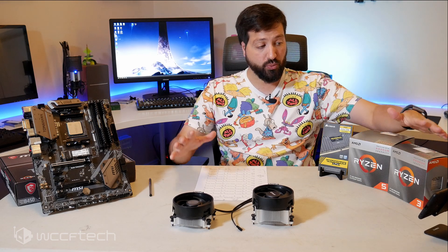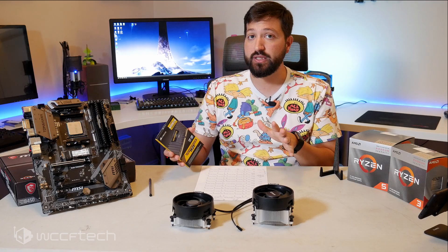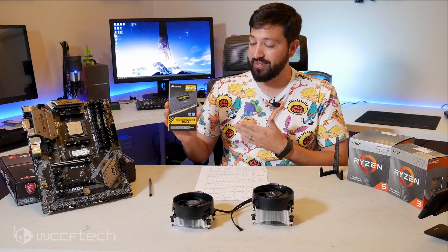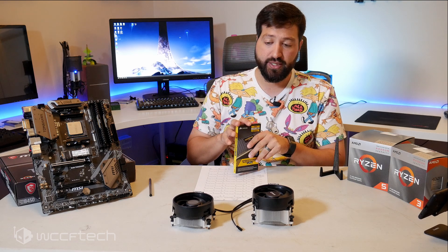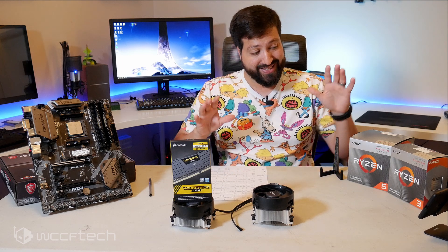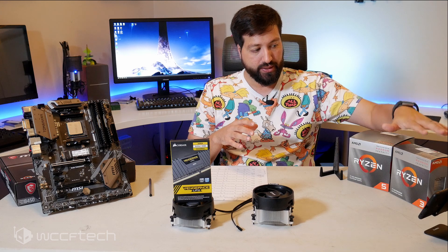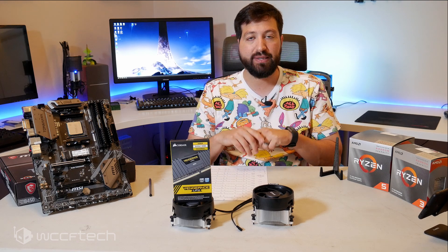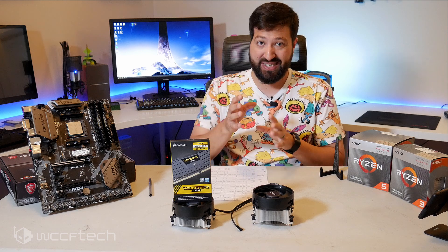At the end of the day it's a balancing game. Don't overspend on memory — when the 2000 series launched, good RAM cost $150+, now it's $45. The 3200G at $100 total with memory is a really good part if you're willing to tweak. If you want better out-of-the-box performance with just a memory overclock and minimal BIOS tuning, the 3400G at $200 with memory suits you better — thermals are also better and it runs quieter.